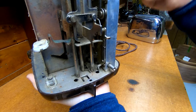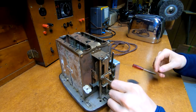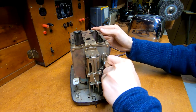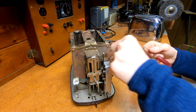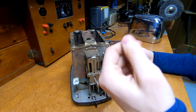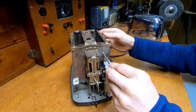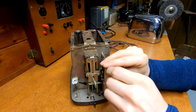This still has quite a bit of motion where it can move up before it expends all of its energy. Also worth pointing out - just like on modern toasters where you can eject it early - because this arm assembly, once it's down, freely floats up and down. Once you push it up far enough, it'll hit the roller and eject the whole thing and shut it off. So once you've pressed it down, you're not stuck with it running. You don't have to unplug the thing. They were at least considering the end user when they built these.